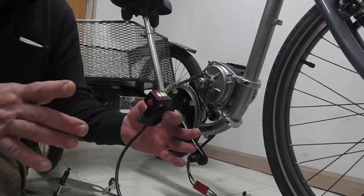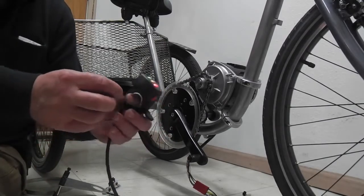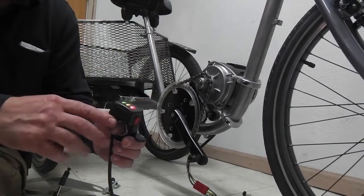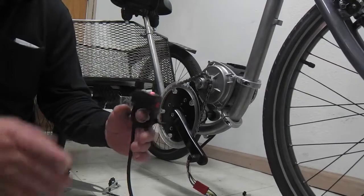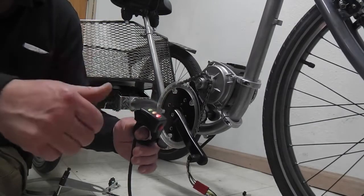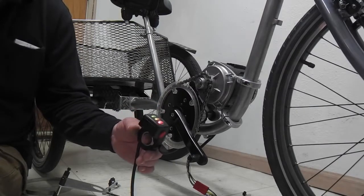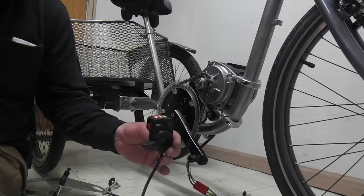The controller is quite good, and it's got a lot of jumpers for settings, and one of the settings it has on it is a soft start setting. I usually like real quick takeoffs, and even with the soft start on, it does give me those quick takeoffs, but I use it because it prevents that jump, that lurch. When you're rolling around crowded areas where there's people or in tight spaces, you don't want to hit the throttle and have it lunge and maybe spook somebody or bump into something. So I use it on the BMC controller because it really is helpful, and it doesn't really slow me down. I don't want to take off like a rocket, but it gives me quick takeoffs but prevents that lunge.